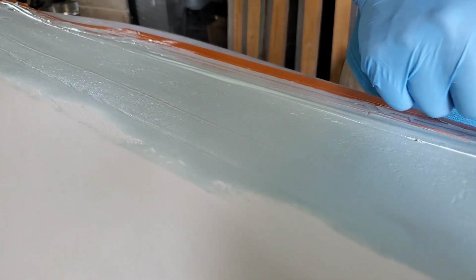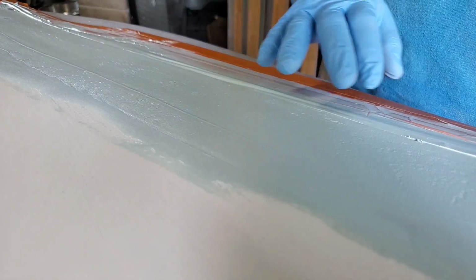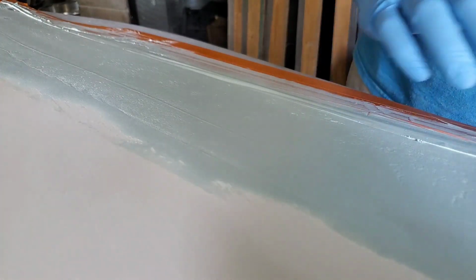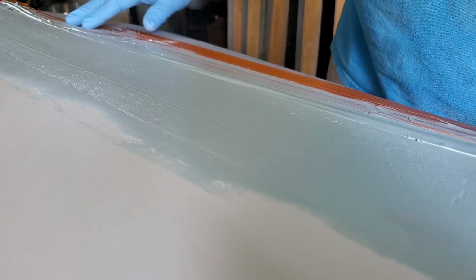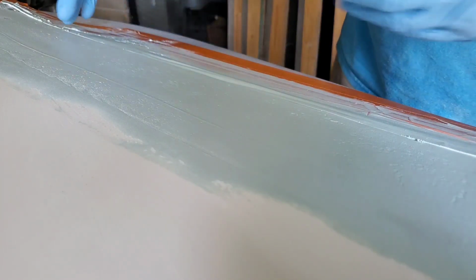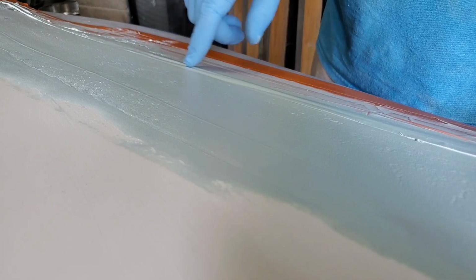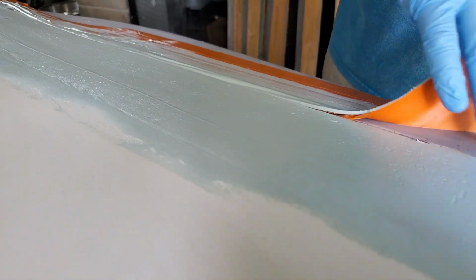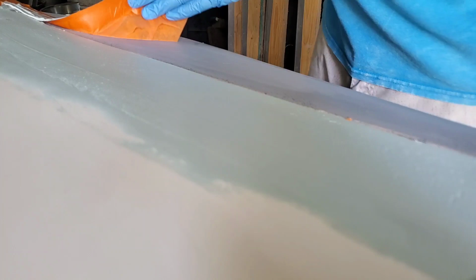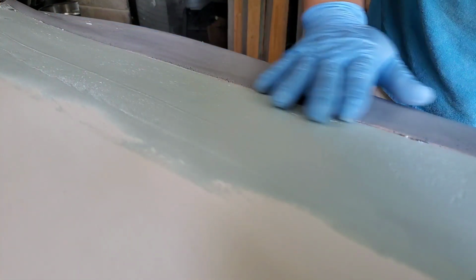It gives a little bit more character. Now I just wiped this top layer. It's just about tacked over. You saw I ran a razor blade right across this here. We went through all that taping just to make this step so much easier, and also to keep all the excess body filler from spilling over into the panel that we already shaped. It's already done. So I ran the razor blade. That cuts the body filler and the tape, exposes our clean surface.